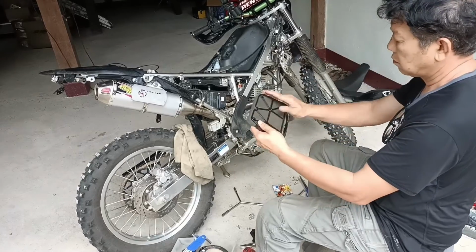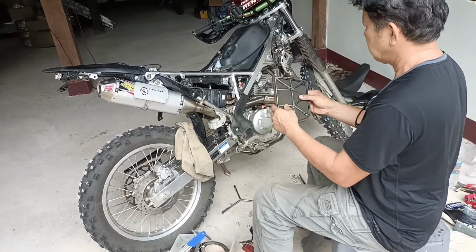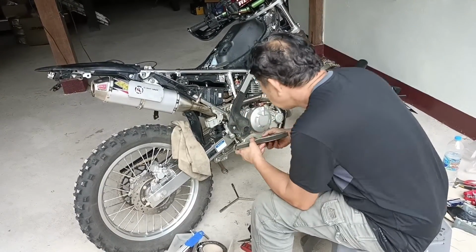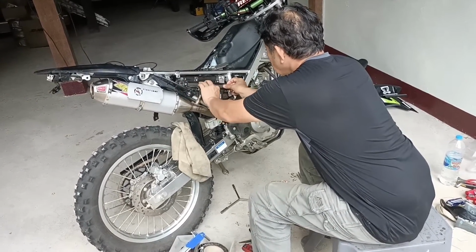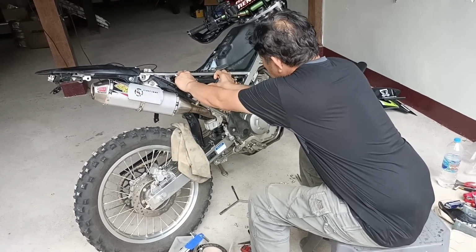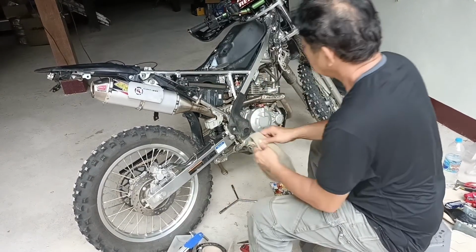Now, it's always advisable to put a little bead of grease around the lip of the airbox so that when you slide the element in, there's no leakage between the edge of the airbox and the filtration element, so you're not getting any contaminants skipping your filter, as it were. Anyway, super easy, just go ahead and slide her in.